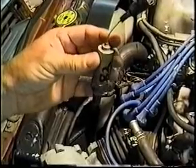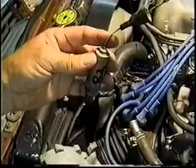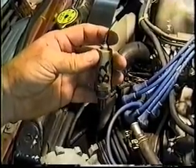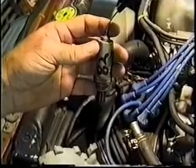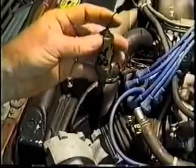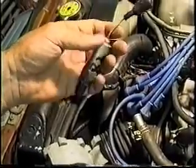That's why it's called an oxygen sensor. The more amount of free oxygen that's left indicates a lean or a rich situation, and it corrects for it. Now, this is not an instant correction — it takes a little bit of time. It will correct it, but it takes a few seconds for it to respond and react. So don't expect this thing to just jump up and show you all kinds of voltage readings if you hit the throttle. It's going to take a little bit for things to move around.